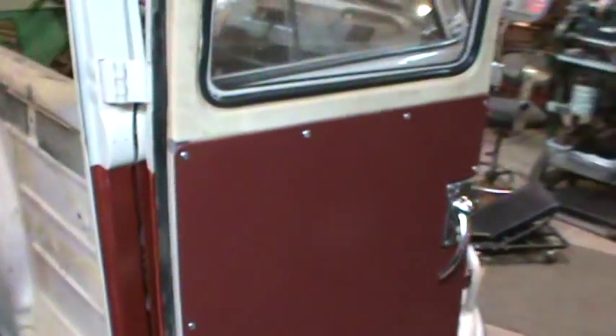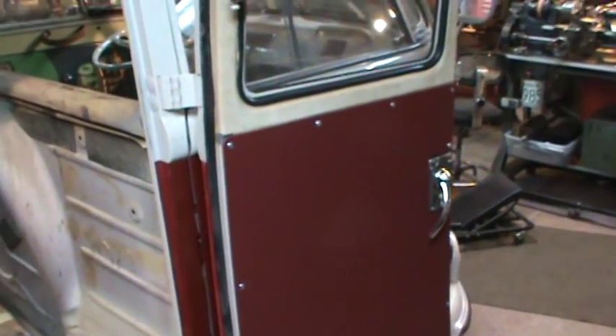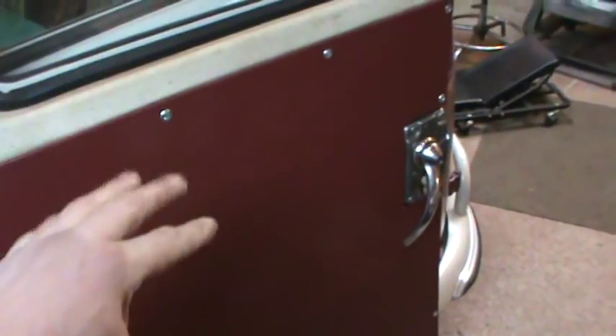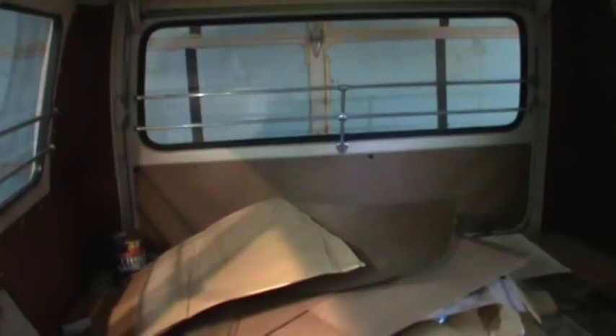That's what I've been doing. You can see what we're going for here. While I've had the panels apart I've been using what I had for Dynamat on the inside of the doors, so these doors actually have more of a feel of weight to them - not that tinny sound. When you close them now it's just a good solid thump. The windows vibrate a little but they have that solid feel now. They're all done going all the way around and all those have the Dynamat behind them.